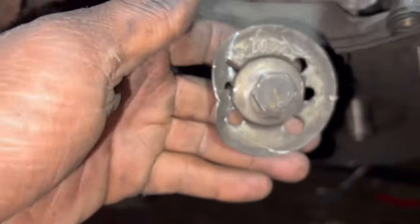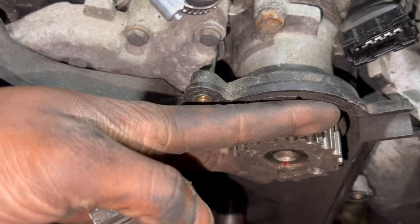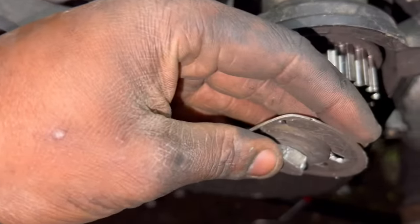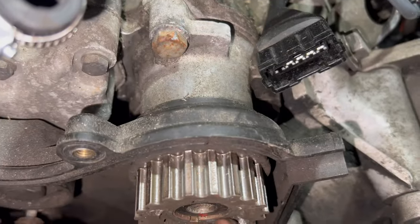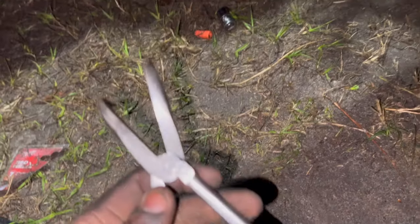Really fine and all. And based off the fuel pump, the thing was pretty old. Usually you're supposed to hear a fuel pump prime once you turn on the key, you can hear it. And I wasn't hearing it during that time, like I'm hearing it now, when I tried to crank it over.